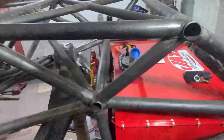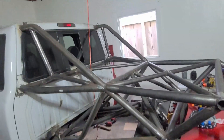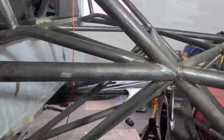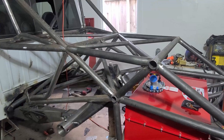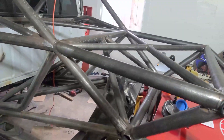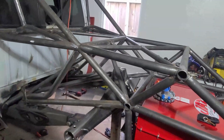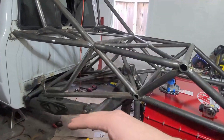The kit could easily get over 30 inches of travel — we're not even pushing it. With the right shock package, if you really wanted to push this four-link kit, you could definitely get big numbers. I'm just looking to stay under 30 for now, probably strapping it around 26, because the front kit can't keep up with more travel than that. I'll be keeping as much up travel as I can, because that's mainly what matters — if you hit a big whoop and it bottoms up the frame, it'll buck the truck forward.